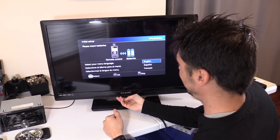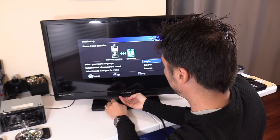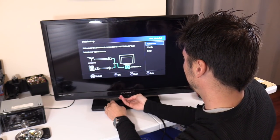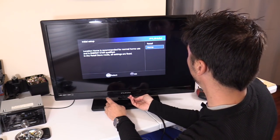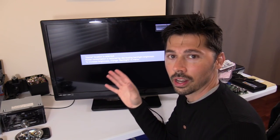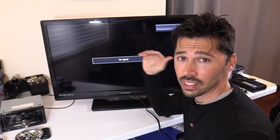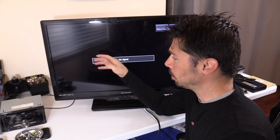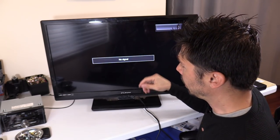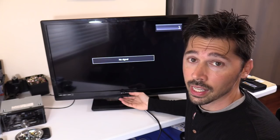Now we have a working TV — how awesome is that! I don't have the remote, so I'll use the buttons on the set. Go to menu and navigate the settings. You want to make sure the backlight settings are set to 50%, because with LED TVs, if you set the backlight to 100% brightness it will burn out the LED strips. I've done a couple of repairs already just replacing LED strips, and every time I check the menu the backlight settings were set to max. Lower your backlight settings and you won't have to worry about that annoying repair.